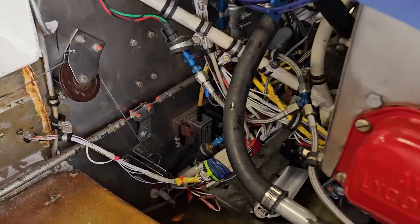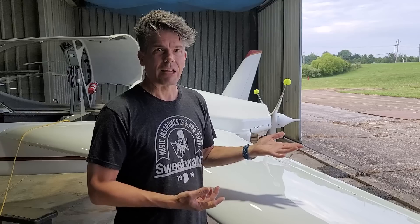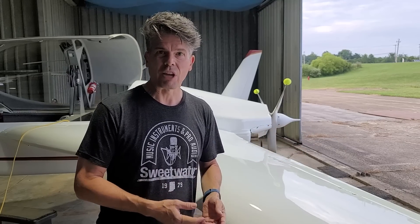Then I had the video where I went to Puget Bay and the electronic ignition failed. I thought it had to be the electronic ignition, because if you have an ignition that is too far advanced, that can cause the problem. Got it back, realized a sensor was bad. I replaced the sensor and flew to Florida. Cylinder head temperatures were still too hot. During the condition inspection in Florida, the A&P doing the engine work re-timed the mag, and the mag was set to 32 degrees before top dead center. It should have been 25. When it's too far advanced like that, it will cause your CHTs to be too high.